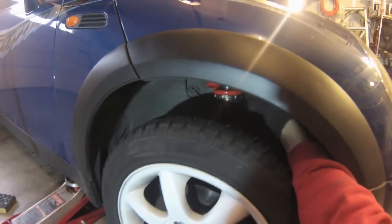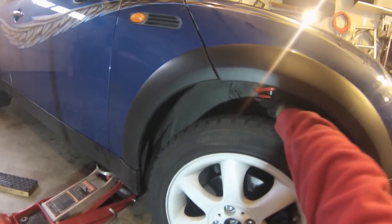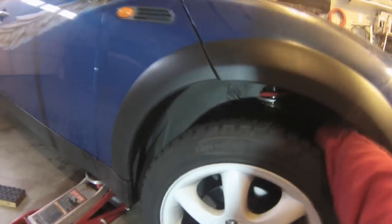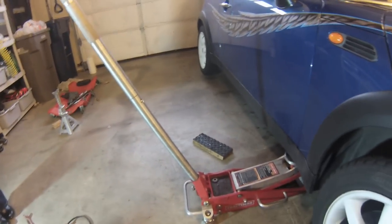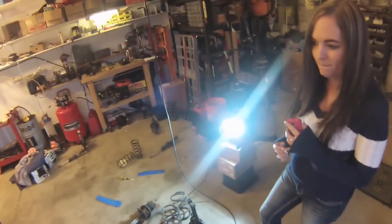So when I lift the car off the ground, the adjustment rings are visible right there, so super easy to adjust on the front. So just back this one off. Got 25 mil to the bottom ring. You won't know until I do both sides because the sway bar evens it out.